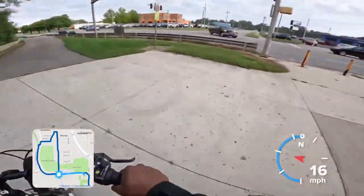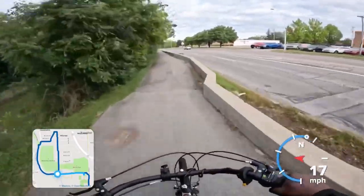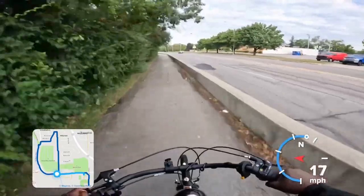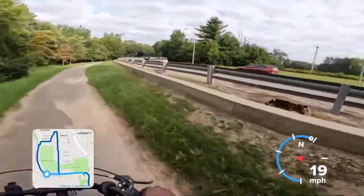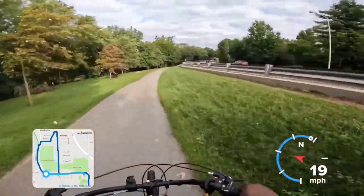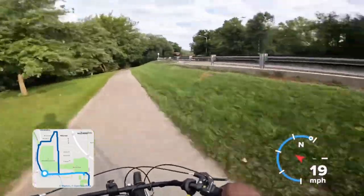Number one, he already removed the stock fenders. Good job, those things are a death trap. Number two, for his situation specifically, because he can't pedal, look into getting the heavy-duty clutch or the racing clutch if you haven't already. Since you can't pedal from a dead stop, you put a lot of stress on the stock clutch and they wear out pretty quick.